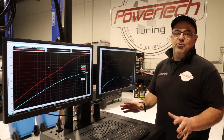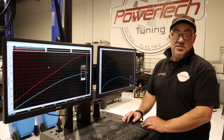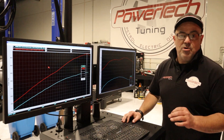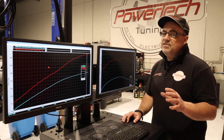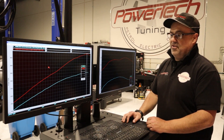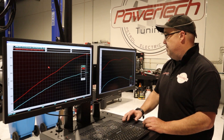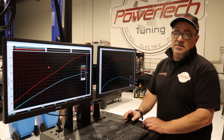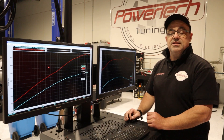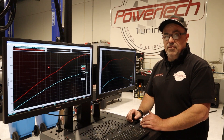Welcome back and the results are in. We've tuned what we like to call our Powertech 600 package - 600 kilowatt package as we refer to it at the crankshaft - and we got some great results but not without a tiny bit of difficulty. We made a solid 170 rear wheel kilowatt gain, going from the low 300s to nearly 500 rear wheel kilowatts. 300 plus Newton meters of torque, but the standard LSA fuel pump did run dry, so we had to fit a Kenny Bell booster pump system which now controls the mixtures perfectly.